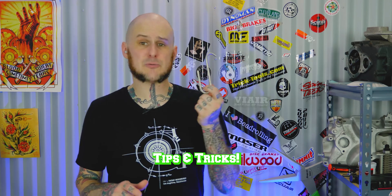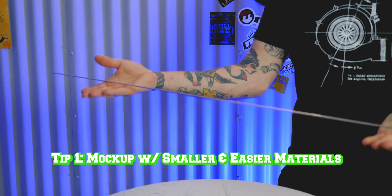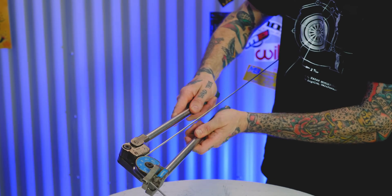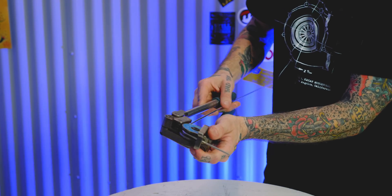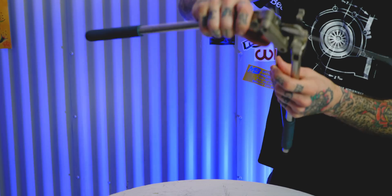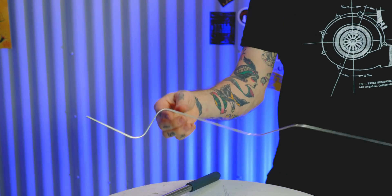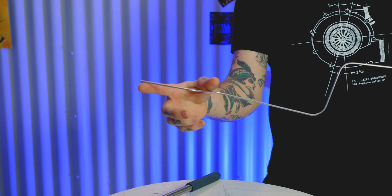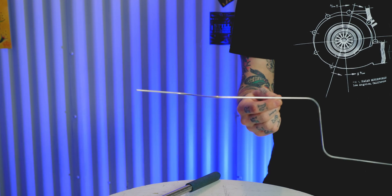Now let's discuss tips and tricks. Probably the biggest thing I can teach you is this: a piece of aluminum TIG welding wire — 1/8-inch thick — for mockup. I will bend an entire line in this material before I ever bend it in stainless steel hard line. This lets me fully visualize what I'm trying to do, see if I don't like how it looks, or spot interferences I didn't anticipate — all without ruining a piece of stainless. This is more accurate when working with 3/16 or 1/4-inch tubing, but I still find it useful for larger sizes like 1/2, 3/8, or 5/16-inch tubing.